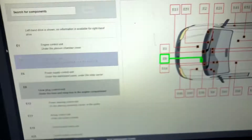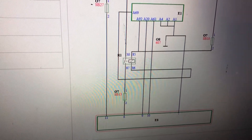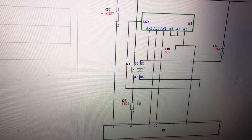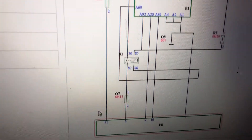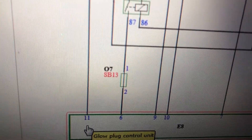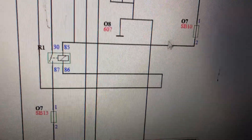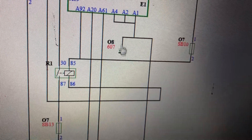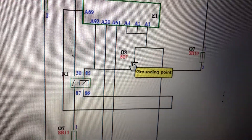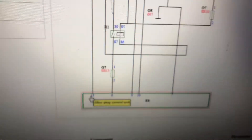So back again we're going to look at the wiring diagram. On our wiring diagram we have power going down to pin 11, and a ground at pin 7 coming from ground point 6 or 7. So we're just going to look at the power and ground - pin 11.